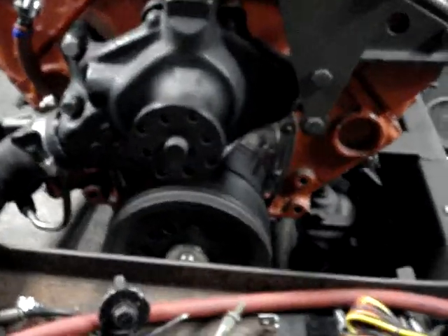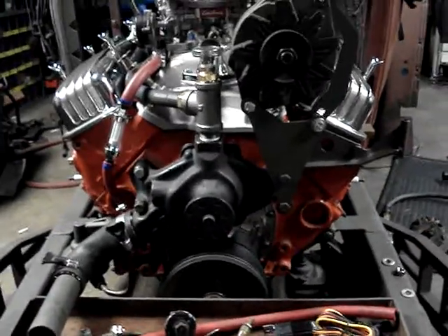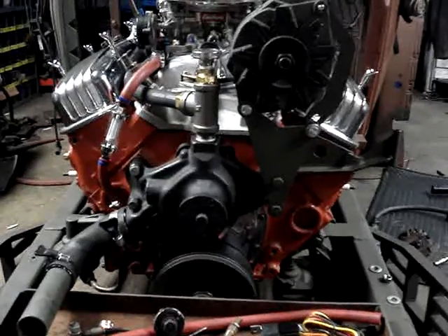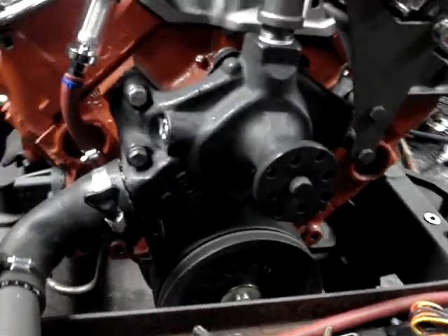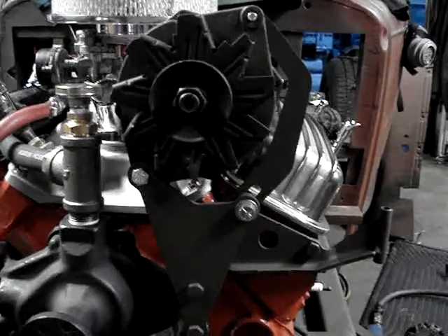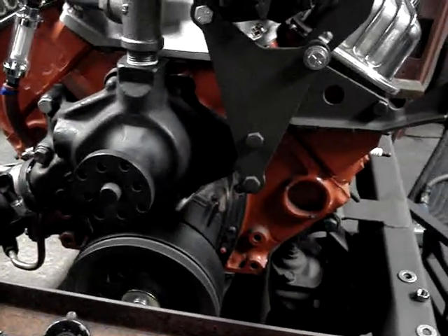A few concerns: I don't have a top pulley yet. The other thing is the way the belt would go — ain't going to be much belt on the water pump pulley, meaning probably the more you gun it, the slower it's going to go. Might have to get a dual pulley. All I was going to do is try it and see what happens.